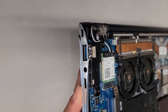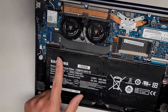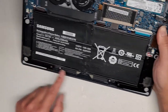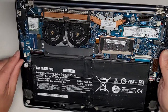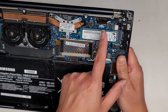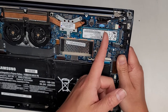There's a micro HDMI, USB 3.0 port, wireless antenna. You also have this cable connecting those two together. I don't know what this little cable is for — maybe a fingerprint sensor. Speaker connector running along here, and then the other speaker running along here, so they actually connected both speakers separately. Not much else — you got the LCD LVDS connector. If you're going to mess with this, after you remove the battery, make sure to press open the laptop and hold the power button for 15 seconds at least to make it safe to work on.